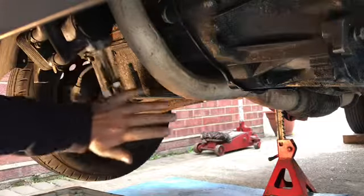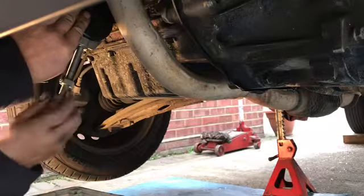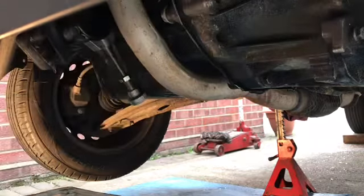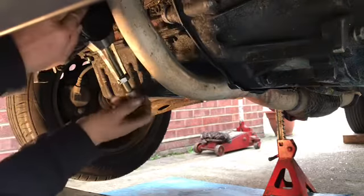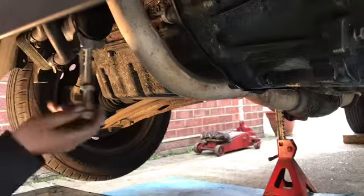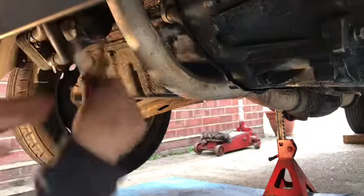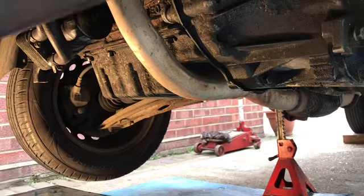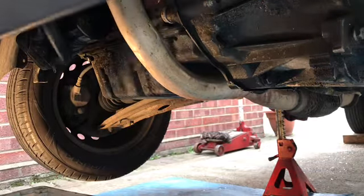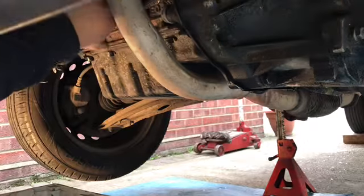These are absolutely brilliant oil filter removals. I say on eBay, 10-12 quid. They're absolutely not a lot. I'm just making sure that I've got that drum underneath, because obviously this oil filter will still be holding oil in there. There'll be the dregs. So what we're going to do now, I've got a bit of rag ready. I've also got the tub underneath, and I'm just going to undo it by hand, just loosely.